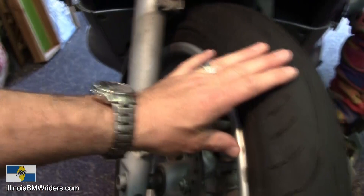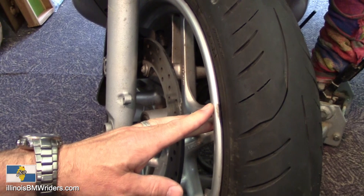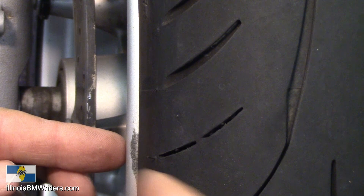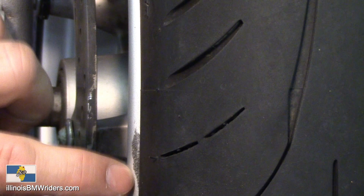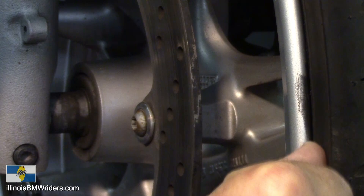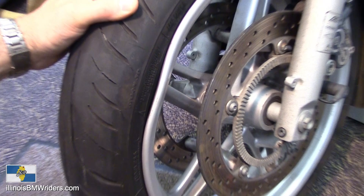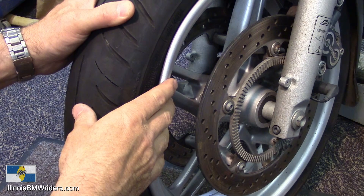You can see there's a little bit of rubber right there that's kind of squished onto the rim itself — this little black area right there by my thumb. That's from the tire being shoved backwards and then smooshing very hard, putting a lot of heat pressure right against there — kind of melted the rubber onto there a little bit. But there's no damage at all on the tire itself. I'm sure the cords are fine. I'm not experiencing anything other than a little bit of a vibration when I'm driving. When I get up over 70 miles an hour, I can start to feel this thumping the front wheel a little bit. So it really survived the damage very well.